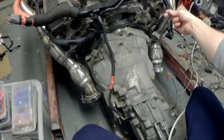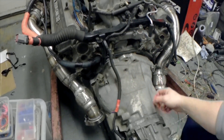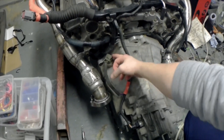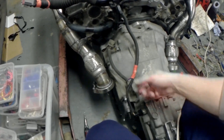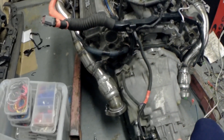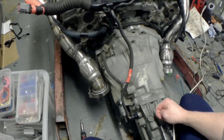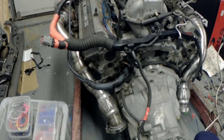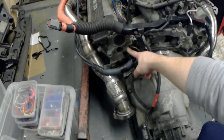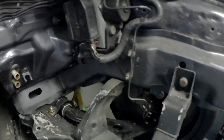Something else I've done was shorten the lambda cables — didn't need to be that long. I've got to tape all this up and make a new support for this. I've also mounted the lambda plug here and put a reversing switch in, because I found the cables in the car that I needed. So that goes through that plug also. That's pretty much the engine all wired up — I don't think there's anything else to go on here. I've got my two big cables, starter and alternator. It needs one big earth — I need to put an earth on the back of the head to the car, which I'm going to probably weld something on around this area, or I may even use one of these boxes, depending on how good that is as an earth.